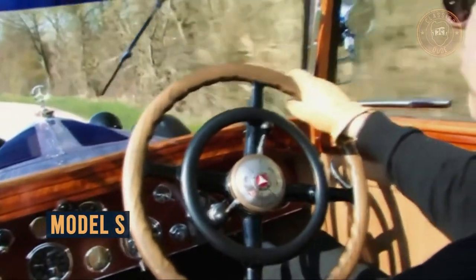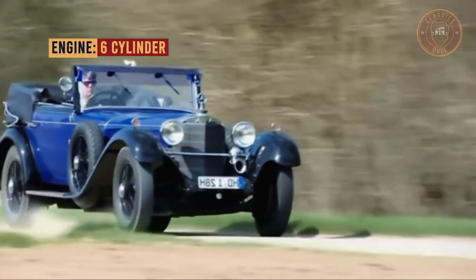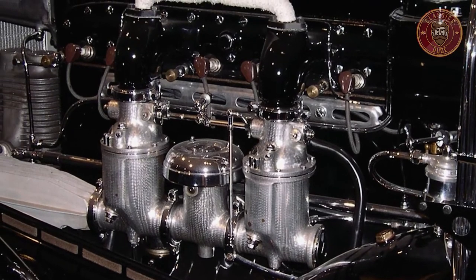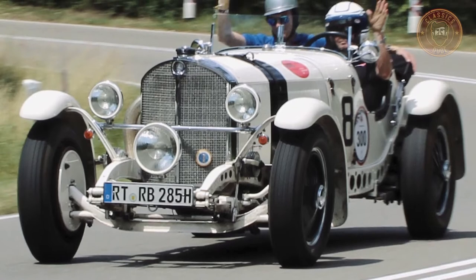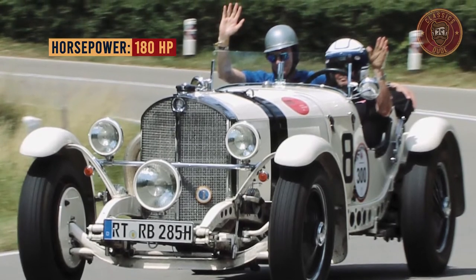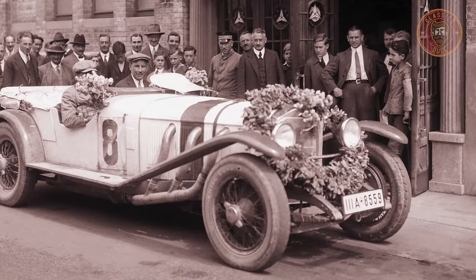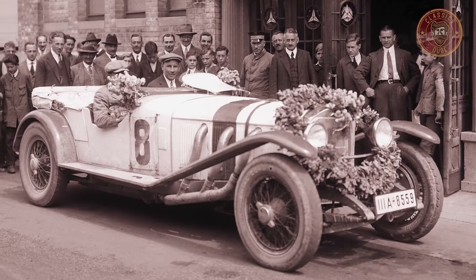Let's begin with the Model S. To raise the engine displacement from 6.3 to 6.7 liters, the six-cylinder engine of Type 630 was built into a new engine with the bore extended by 4 millimeters. A design code of M06 was given to this engine, using the naming system that became popular after the merger. With the supercharger engaged, the new M06 engine increased by 40 horsepower, generating 180 HP. The Model K chassis dimensions were retained, but the frame was substantially lowered and the engine was shifted 30 centimeters backward, improving reliability and handling.